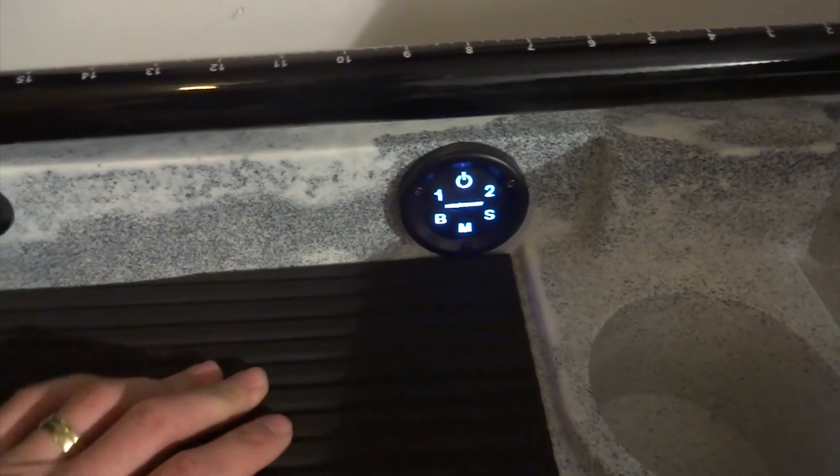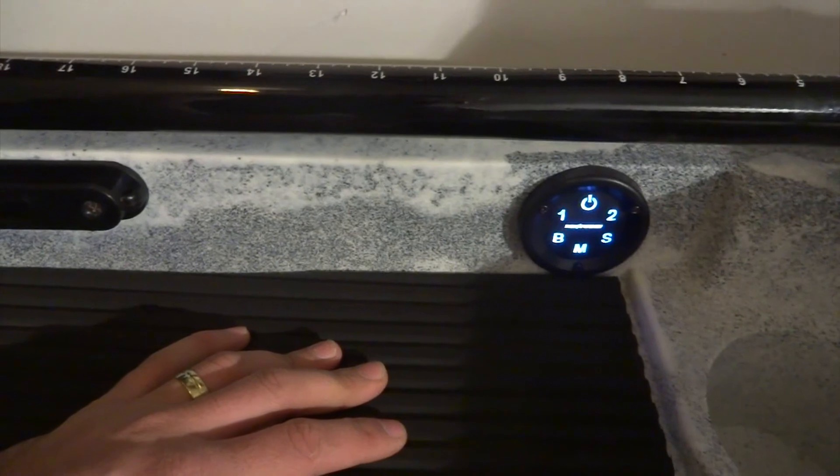This will be extra good when I put the LED lights on the kayak so I don't have to drill holes. I looked up a couple of videos and they were drilling holes into the kayak on the side and doing rivets. I asked a couple of pros who've been fishing with kayaks for a long time and they told me if you drill holes just use a bolt and marine glue — silicone — but by any means do not put rivets, because after a while the hole will expand, the rivets will come out, and they will damage your kayak.